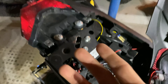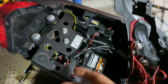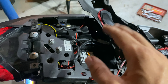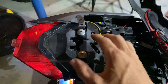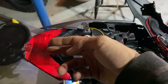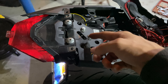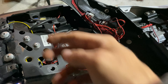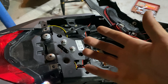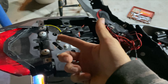So all you do is — these are the wires. I believe the yellow wires that came with this sub unit right here for the taillight. All you do is you connect these, and I'll get more into detail in a few minutes. All you do is you find the leads — you have a positive for your taillight and everything like that. You kind of want to ignore that. The difference maker is going to be with your turn signal lights. So the wiring that goes back, you need to find which side is left and which one is right. And then where the grounds lead.